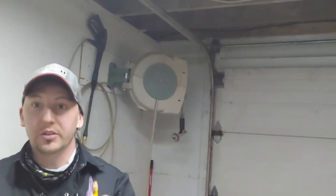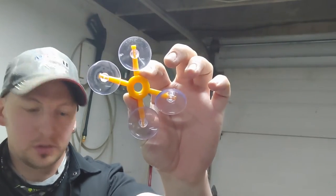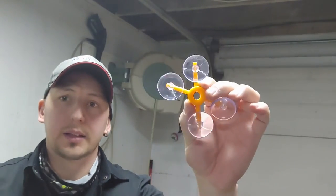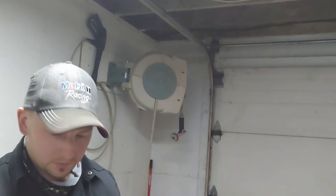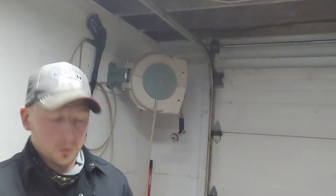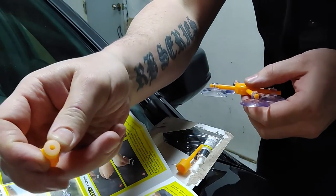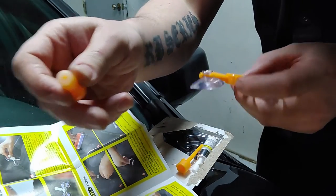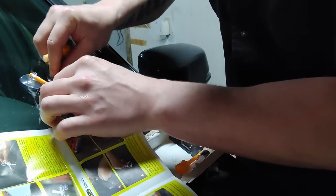It hasn't spread out. In the kit you have this little spider kind of thing that you stick on your windshield. Before doing that, clean out the spot and clean out your windshield — already done that. The kit is supposed to be good for multiple repairs. You need to align the sucker point right on the middle of the area that needs to be repaired.